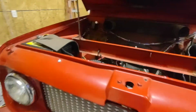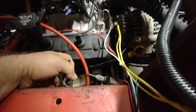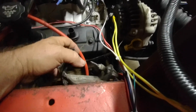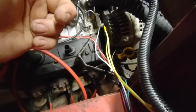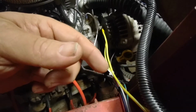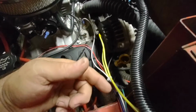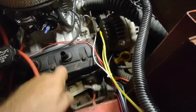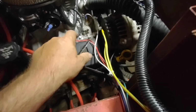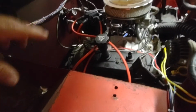Anyway, the front axle for the Blazer was vacuum actuated, and here is the bracketry. There's supposed to be a vacuum pod hooked to that cable, and then there's a vacuum pod that sits here with a vacuum line. When you pulled the shift lever for the transfer case, it actuated a vacuum switch, and it would vacuum actuate that pod, pulling the cable to engage the front axle. So I was originally thinking of just mounting this to the sidewall here in the fender well, and then running a hard line cable through the firewall with a push-pull end that you could lock in place.